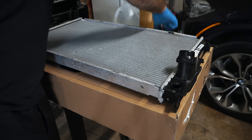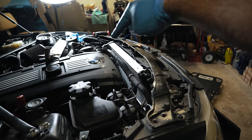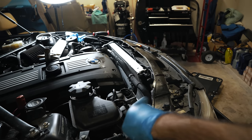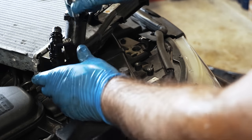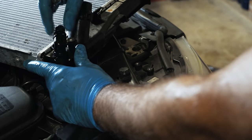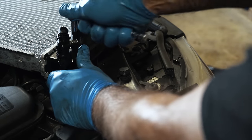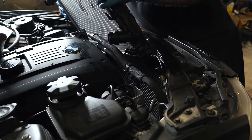So here's a new radiator. I'm going to assemble the line on here in advance. You've got to start with that side. I tried angling like this and getting that hose on but I wasn't able to get it on after. So force the driver's side down and then follow up with the passenger side, then put that hose on from underneath and then continue to slide down. Actually, this fitting can be screwed on off the car and that hose just clicks into place, so you can remove it easily from the car to save you some time. The opposite side doesn't, but this side does. Just attach that to the new radiator and remove the hose from here when you're removing the old radiator off the car. Start by putting the driver's side in and getting it in this little groove.